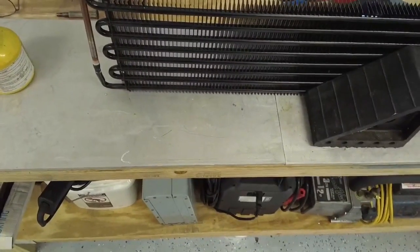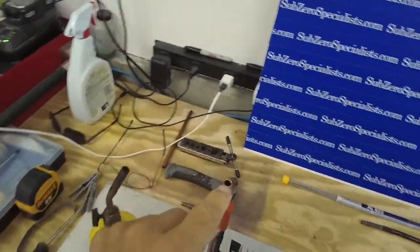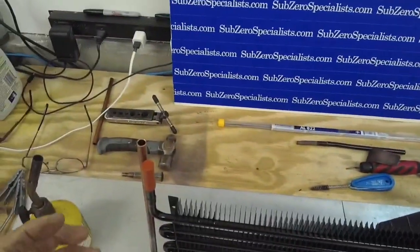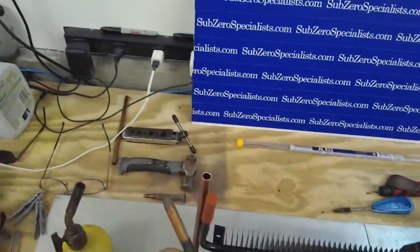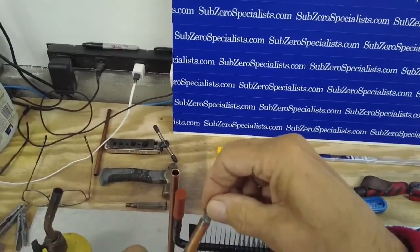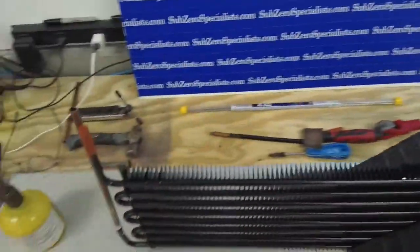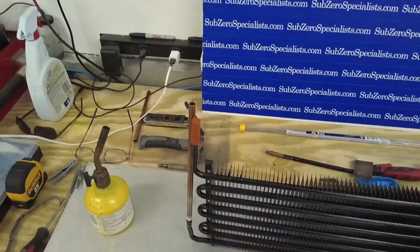That's done. Now you have a salvaged evaporator coil which we will reuse. I've taken the liberty of swagging this end of the tubing out to 5/16, because the evaporator system in this refrigerator has a 5/16 tubing that goes into that end. You can see this tubing that goes in is 5/16, so we swagged that out. We're going to seal this off with some heat shrink tubing, and voila — that's how you fix an aluminum evaporator and solder aluminum to copper.